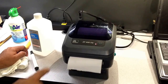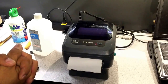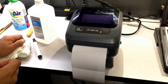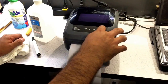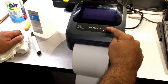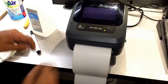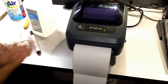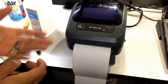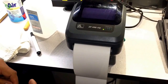Just wait until the printer gets ready and does a self-calibration. If you want to do the self-calibration manually, push the feed button once, wait until it flashes once and then twice — that will send the command to the printer to do a self-calibration, which will automatically check the label size and calibrate it for you. Now your printer is ready to go. Let us know if you have any questions. Good day!